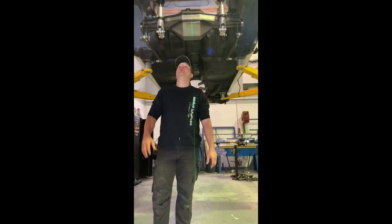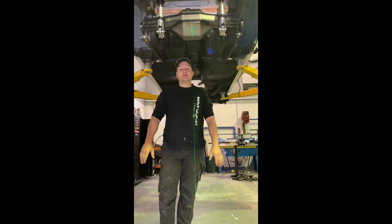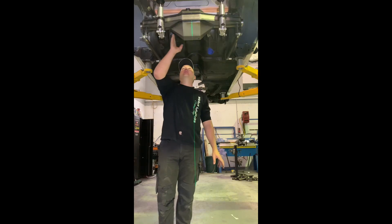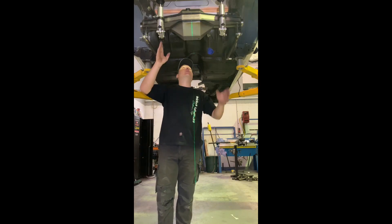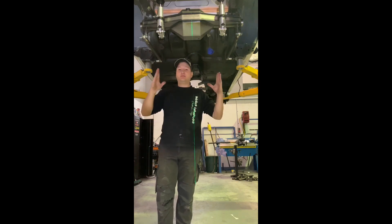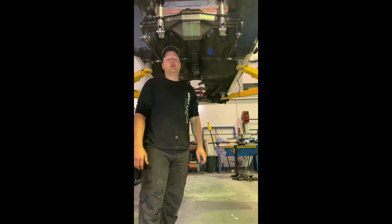There's my little pointer for you when you're setting up your coilovers. I work off a centre line — I don't work off a measurement to the rail because in a lot of cases the rails, like I said, they're not always centred. So check your centre line, measure out from your centre line, take a couple of other measurements and you should be fine. I also set my shocks up vertical — straight up and down, plumb, both ways. Some guys set them up angled in or whatever — that's their way of doing it. I prefer to leave my shocks perpendicular.